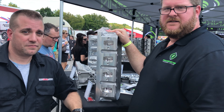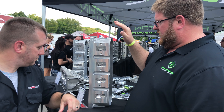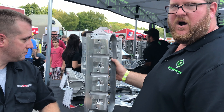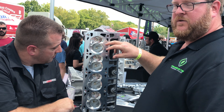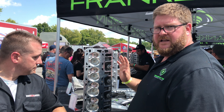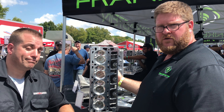We take the factory casting — you guys can either send it in or we can provide cores — and we replace all the valve guides on the heads, which is one of the common problems with dropping the valves. We also replace all the exhaust valves and refresh all the intake valves. So it basically alleviates all the problems with the famous dropping the valves and destroying motors.